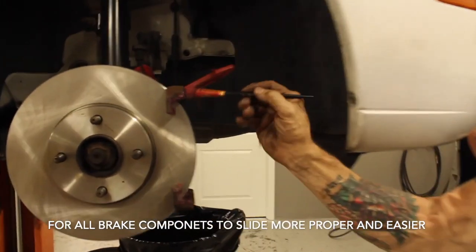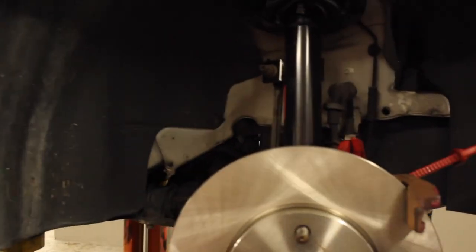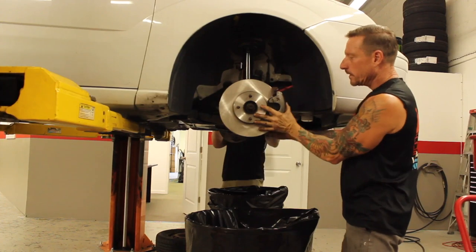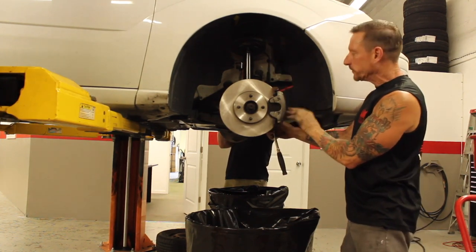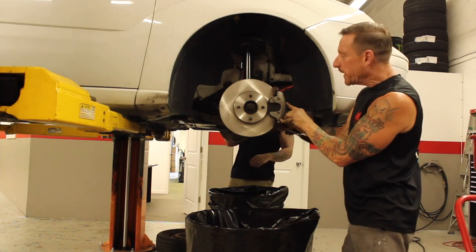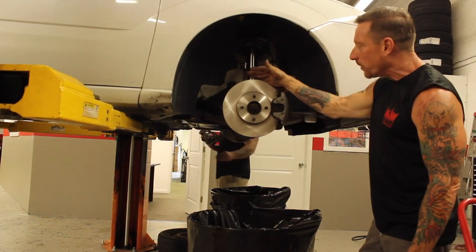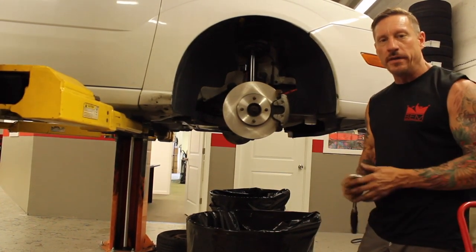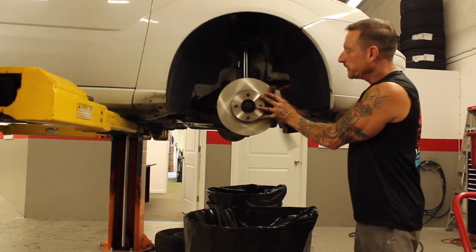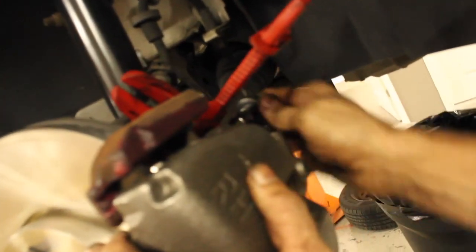Synthetic wheel bearing grease across the sliding points, as we heard Bob talk about earlier. This will allow things to slide much smoother and keep from sticking. So while Bob works on the left-hand side, I'm working on the right-hand side. We notice that the top of this says RH, which means right-hand side. We've transferred our caliper bracket over. We're now holding our caliper with the pad onto the new rotor assembly. We now call this a loaded caliper because it contains the brake pad on the inboard side. We're tightening it up so they'll slide nice and easy and give the customer a very smooth brake pedal. These are the slide pins that we talked about earlier, with synthetic wheel bearing grease.